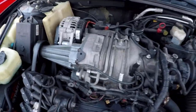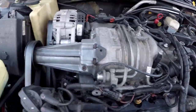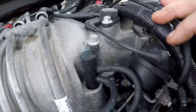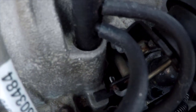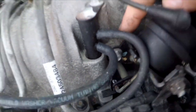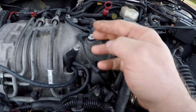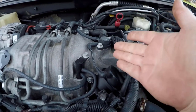On your M90 — and this may be a little different from car to car and from Grand Prix to Grand Prix — right here you will find the boost control valve. This is a vacuum actuated valve that moves this lever here, that opens a butterfly valve inside which bypasses pressurized air — on this side of the supercharger — back up into the non-pressurized side. That's what keeps the supercharger from making boost.